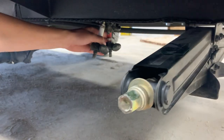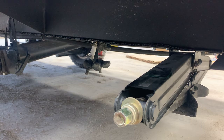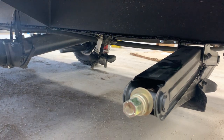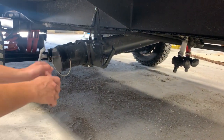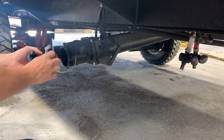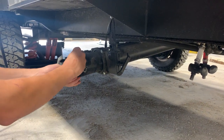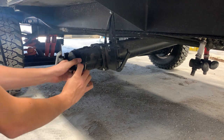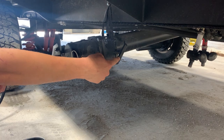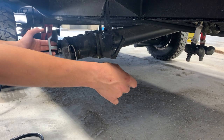You've got your two low point drains — a hot and a cold line. If you're wanting to drain all the lines, that's where you would do so. It helps stop water from going stale or stagnant, or if you're working on a faucet it helps with less water leaking inside. Then you've got your main sewer outlet. Your sewer hose has the same end — you just twist this cap off; it has two ears that line up with the notches, you line them up and twist into place and it locks in. You've got your black and gray tank. You always want to empty your black tank first — that's your dirtiest water, filled from your toilets — and then follow that with the gray tank, which is typically cleaner water filled from your sinks and showers.